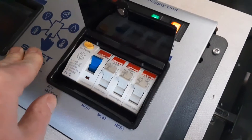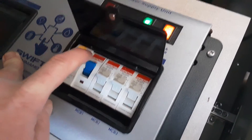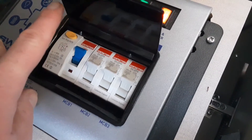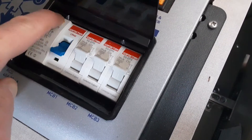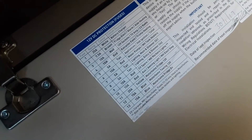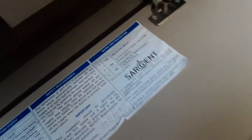A tip regarding the household trip switches: if you hit the test switch when connected to power on site and it doesn't drop down, it means there is no power coming into the caravan. If it does drop down, that means there is power coming into the van. That list of fuses is just inside this door — your 12-volt fuses on the left-hand side and your 240V trip switches on the right-hand side.